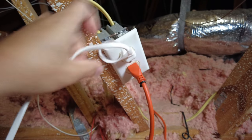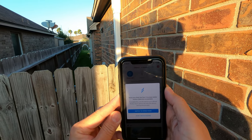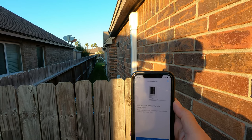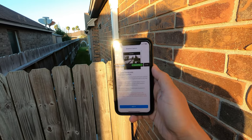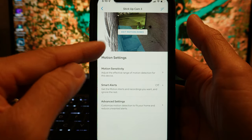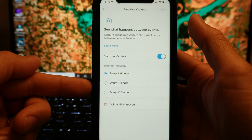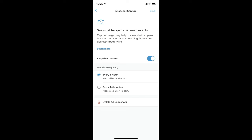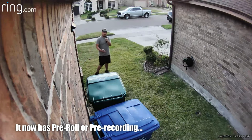When you open the Ring app, it will notify you that you now have the option to change the Ring Stick Up Cam to wired mode. To do so, you need to be close to the camera and redo the setup — choose your Wi-Fi network, click continue, and wait for setup to finish. You'll now have a wider field of view for motion zones since it's camera-based instead of PIR. You can also increase snapshot capture frequency to every 30 seconds instead of every 14 minutes on battery power. It's now reliable in motion detection and has a pre-recording feature that records three to six seconds before motion is detected.